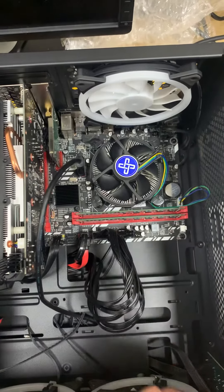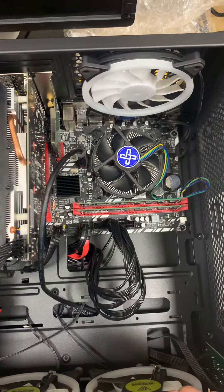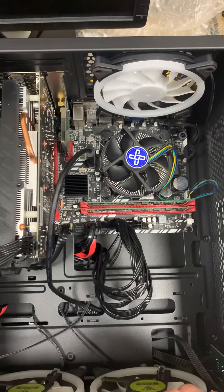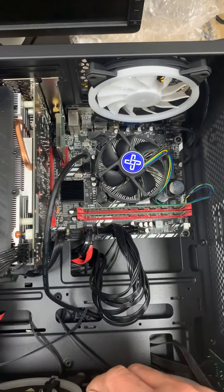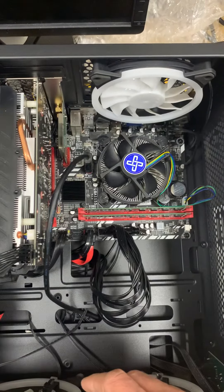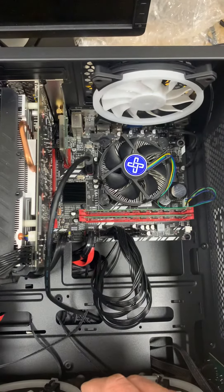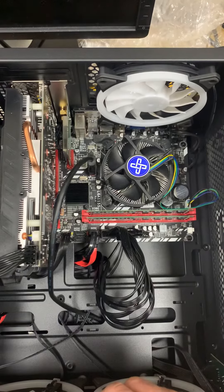The very first thing, if you get sometimes freezing or blue screen, is that any of these connections might come loose. Because most gaming PCs are sent via courier, there is a good chance they throw these boxes, so no matter how well you package them, there is a chance that RAM or the graphics card may come loose.